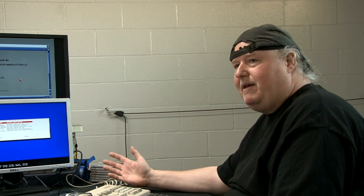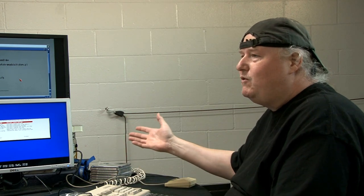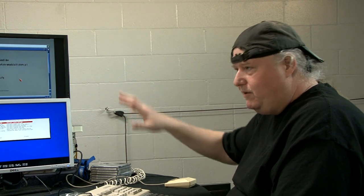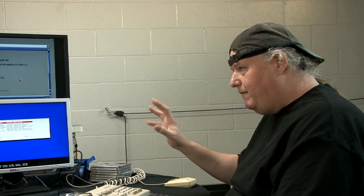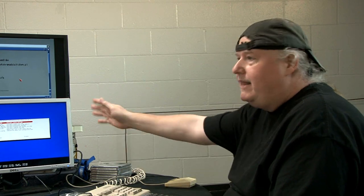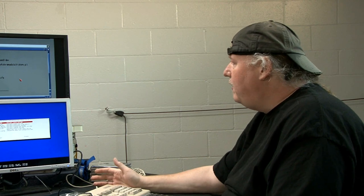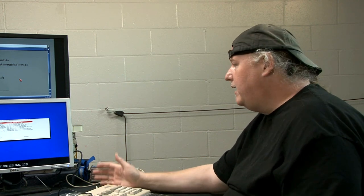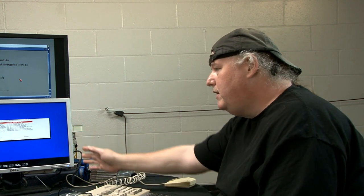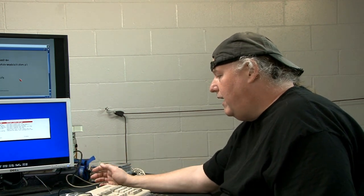And that's set up the same way you would in WinUAE. So if you set up a virtual hard drive in WinUAE, it works the same way. You set up that file and you copy stuff in or leave it blank. Mine I left blank, and I copied over the hard drive file that I created in WinUAE. I copied it directly over to the PiStorm through WinSCP, onto the SD card.